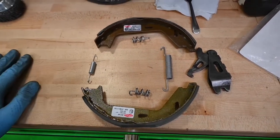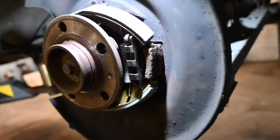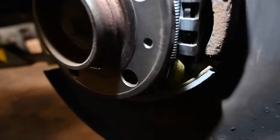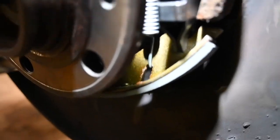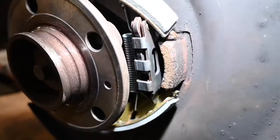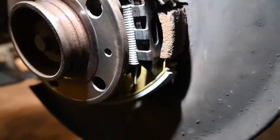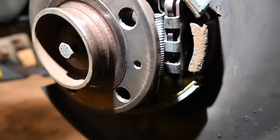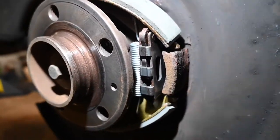So I'm going to get it in the vehicle and then show you what I've done. Okay, so that didn't actually take too long at all. As I suggested before, get the upper and the lower handbrake shoes in there with that retaining spring — it's very, very important. Make sure it's located at the top and the bottom and it sits behind the lever. Now what I did in this respect — I actually put that lever in first, then I just manipulated the shoes with the spring attached around it. It does take a little bit of force but don't be shy to give it a little bit because that spring can take quite a lot. And as long as it's orientated correctly as you took it out, you won't have any problems.